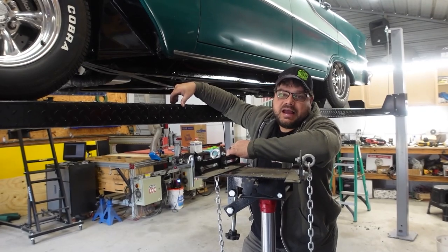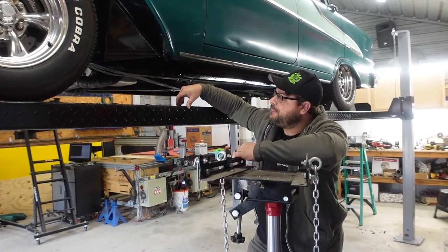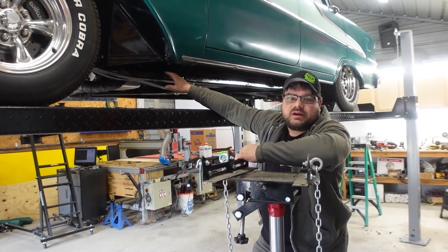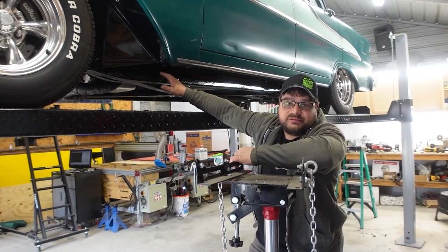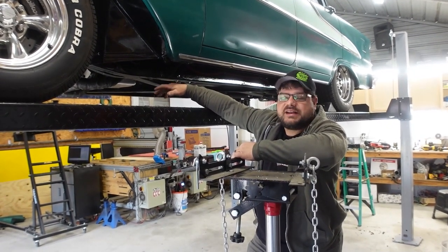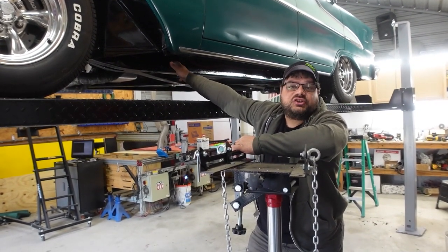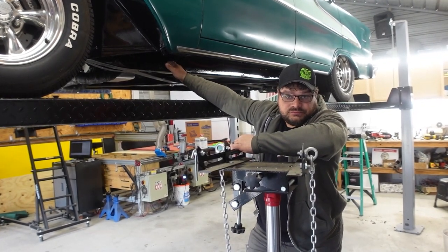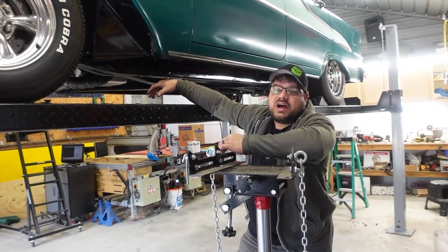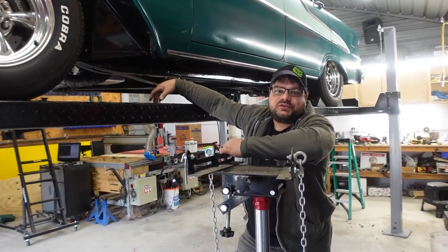So that leads us to now. We already put our peepers up in there, and the torque converter is still hooked to the flywheel. We don't have any line pressure though. So our next question is, is the torque converter still hooked to the transmission pump? We don't know, but we're about to find out, because now we have to pull the transmission out of this thing.